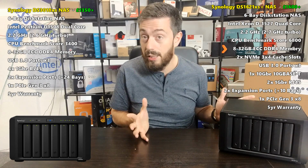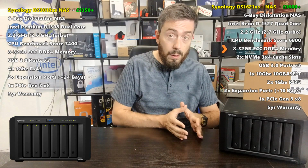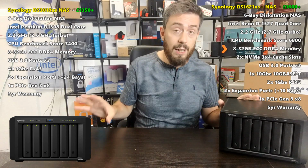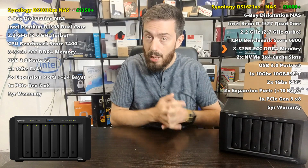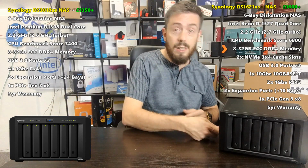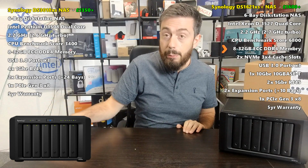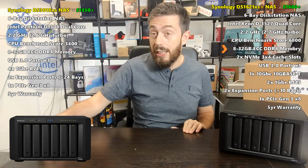One, obviously because of the 10 GBE, but two, because the system can deliver that throughput successfully with the same SSD or hard drive media inside, with and without cache. It will provide the same, if not better, than the 3018 to a network for lots of connected individuals. And that's important, because you can use a 10G equipped system or a Thunderbolt to 10G adapter, connect into the device, and then get that throughput directly. That is possible. But if you funnel this device into a switch, you're going to have 4 GBE, or with the upgrade card, a few more, feeding into a LAG-supported switch and lots of connected users.